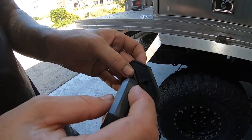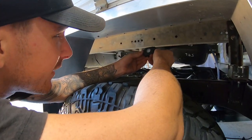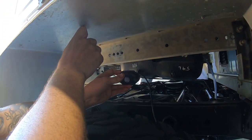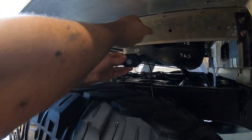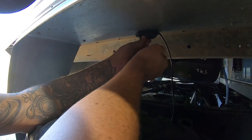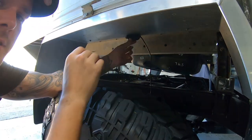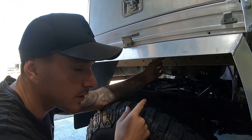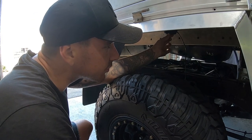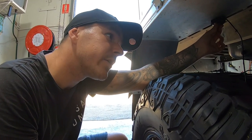So like I said, because of that groove it just slots in like that — the wire will come out the side. I'm thinking of mounting it up into the top of the mudguard here where I can't see any tire marks, and I can't imagine the wheel flexes that high given the tray has been lifted. I'll mount it somewhere up there, screw it up with a torx self-drilling screw, and neatly run the wire to a central point. I'll do that for all four corners and find a central spot for the control box after, so I know the wires reach.